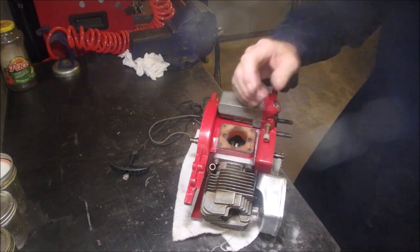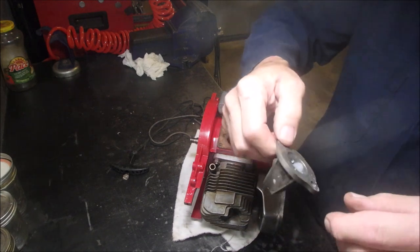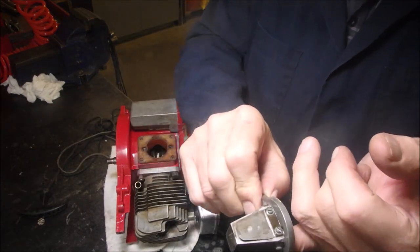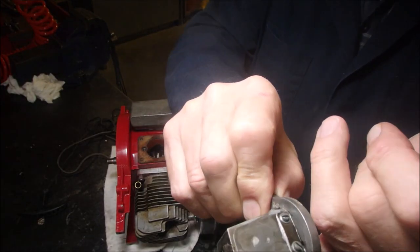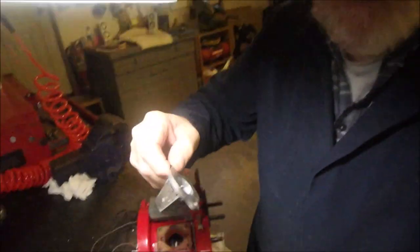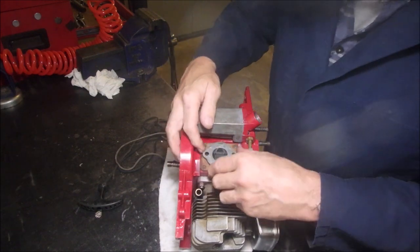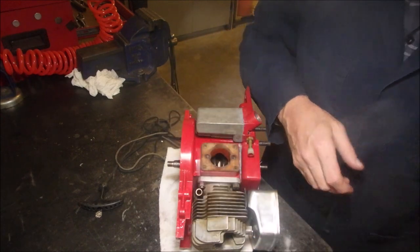I still haven't decided. Oh, look at this — I'm going to change the subject. This is what they call a reed. Has anybody heard of the reed of two-stroke engines? There are four little flappers in here. They have to test back pressure, but if you blow through them and then suck in, you should get a seal — and you do. I'm wondering if I should mount that reed on there, but no, it has to be elevated. I've heard it, so I won't do that.